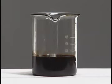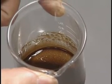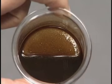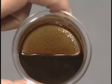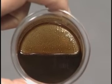If you see whitish contamination, as if milk has been mixed in, the chances are that coolant has leaked into the oil. In a severe case, you may notice a significant rise in the oil level far above the upper level mark, in addition to the milky appearance. If this is the case, investigate the source of this contamination.